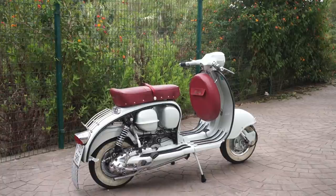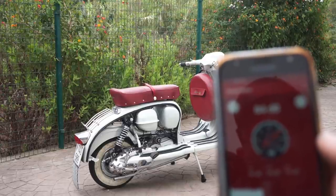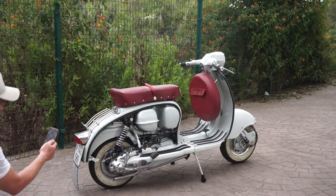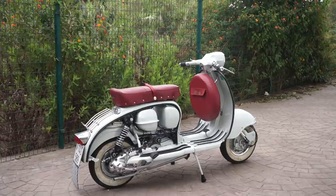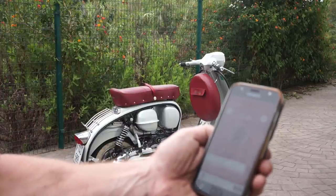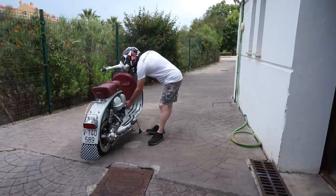I've been and got my sound meter — basically my phone with a decibel meter on it. So from here, from this distance, about two and a half metres, I reckon it's about 84 decibels. We're going to go a little closer. This gives me an average — it actually gives you a minimum, maximum and an average. It's given me an average of 86 decibels. Let's check this out and have a little test drive and see how it goes.